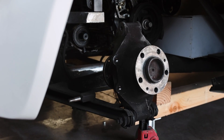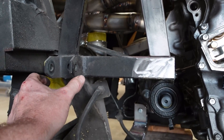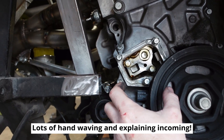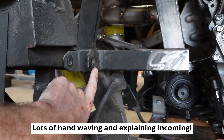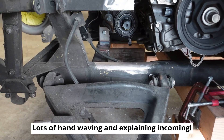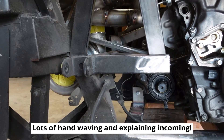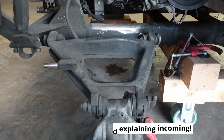Stub axles — I can't even make drive axles until we have stub axles and know what it's going to be on the outside. We know what the transmission takes, but there are just so many puzzle pieces. We've got to be thinking 20 moves ahead for any of this to work. Many episodes ago, we had another one of these upper control arm mounts sitting about right here, and we cut it off along with the tube it was attached to. So now we need to draw up a new one and reattach it. The distance between those is a lot closer together than it was before, but that's not going to affect the geometry or the way the suspension works, and it's not going to change any of our camber or caster curves.